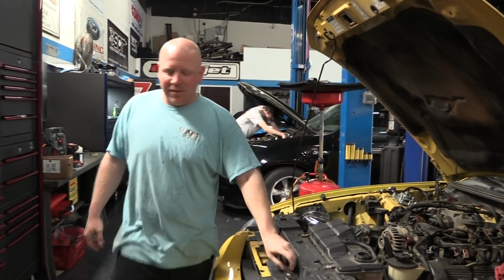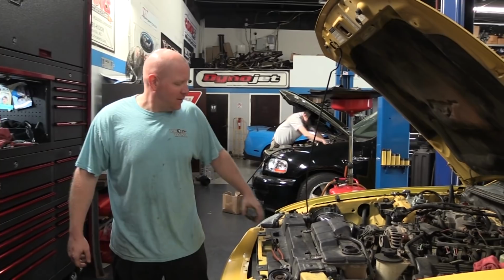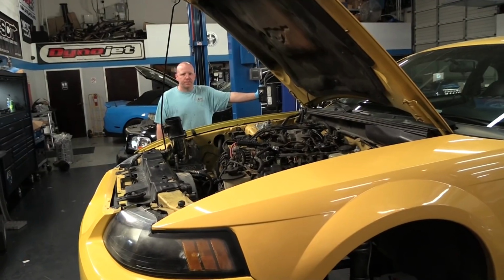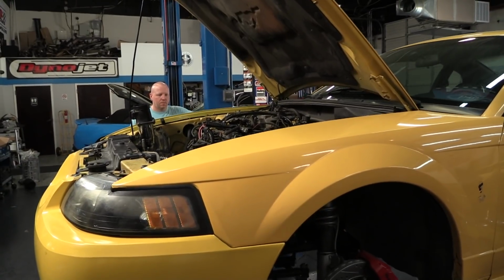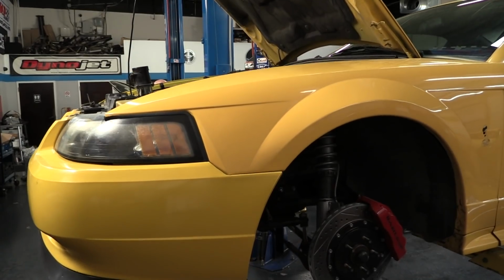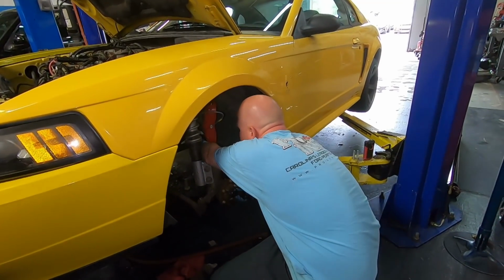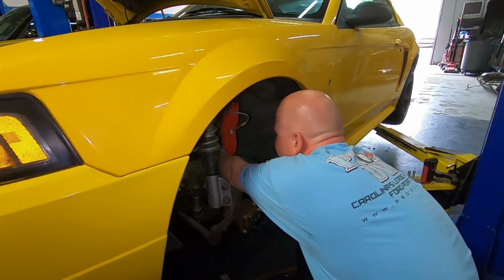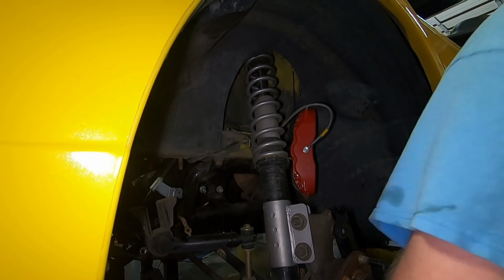Getting everything wired up is definitely the biggest challenge in this whole swap. Another big advantage a shop like this has is a lift. The Mustang's engine most easily comes out of the car by unbolting the suspension and K-member and dropping it right out the bottom. That means doing the swap with the car sitting on jack stands in your driveway or your shop simply isn't practical. Still, it can be done if you're determined.